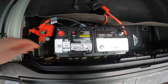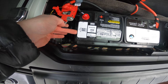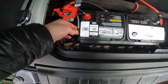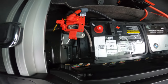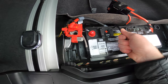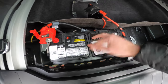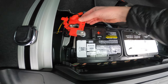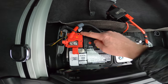Here's the new battery slid into place. First thing I'll do is connect our ventilation tube right here — there's a small hole you can feel right there, just wiggle that into place. Now we can slide the battery in up against the metal stop located right there, so the battery can only slide so far over. Don't forget to take off this protective safety cap.